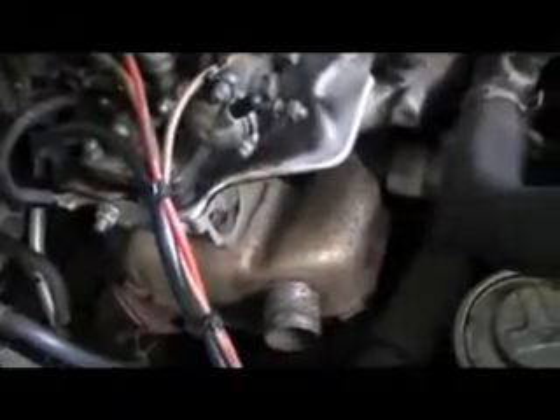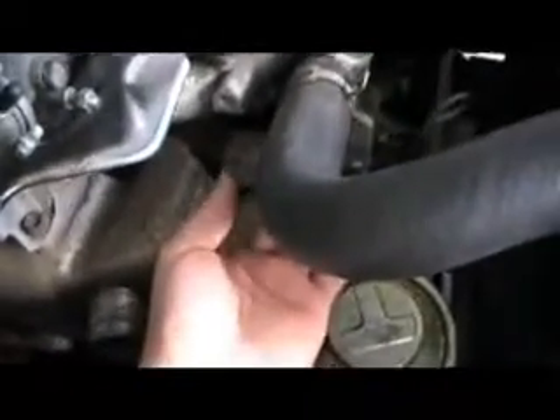Another question was how did I get rid of the EGR valve? Since they don't make an EGR valve delete plate — nobody makes one — you have to make your own. Mine took some time and effort. Another thing that's really important: you have to keep a part of the original EGR valve, just the part that connects to the exhaust manifold, so you can cap everything off.